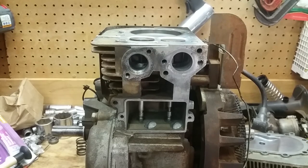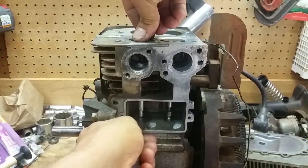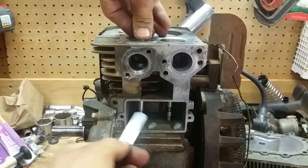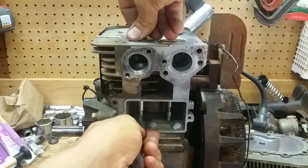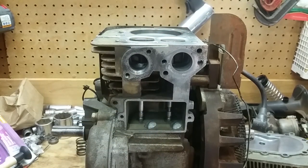We got 10 thousandths of an inch right here. And it fits and it's good. Just a tiny bit of resistance here on the exhaust valve. And then we got 11 thousandths here. Pushing down. And it's tighter, but we got 11 thousandths here, and that's the upper spec for this. And then let's try 12 thousandths.